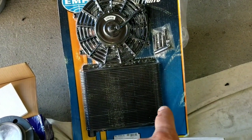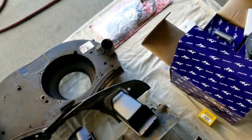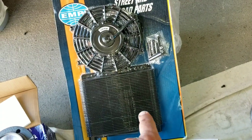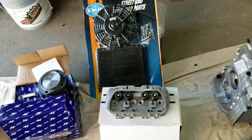So we're going to have the doghouse fan shroud, and in addition to that, a secondary flow of the oil to go through this additional oil cooler, and also through a spin-on oil filter.